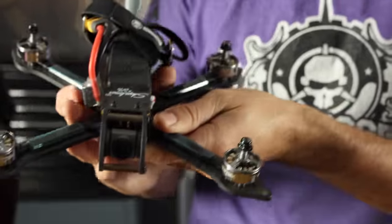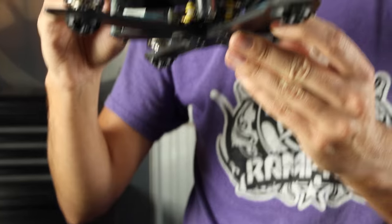Oh yeah, it's like super slammed. So what that means is between having that shorter distance between the mounting holes and the front of the lens and having that ultra wide field of view, you're gonna have to push the camera way further forward in the frame than you may have had to before. So for comparison, this is the Skyliner HD built with the original DJI air unit.